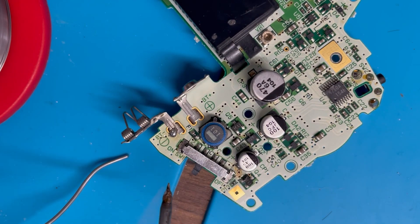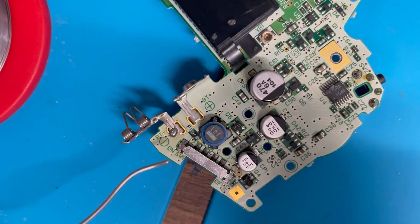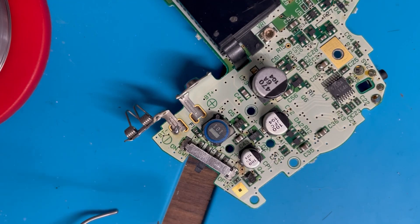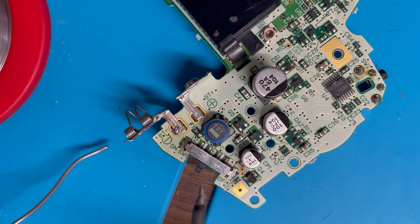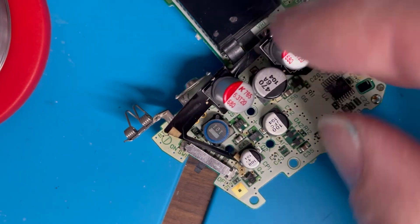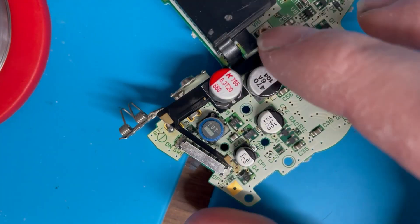If you don't do that step you will have the de-hum kit board in place and you'll lightly burn the de-hum kit, so it's important to pre-tin this so that solder is flowing onto the spring. Once it's tinned, don't leave your iron on for a long while otherwise the solder will just fall through the bottom. With that all pre-tinned, place the board down onto the GBA.